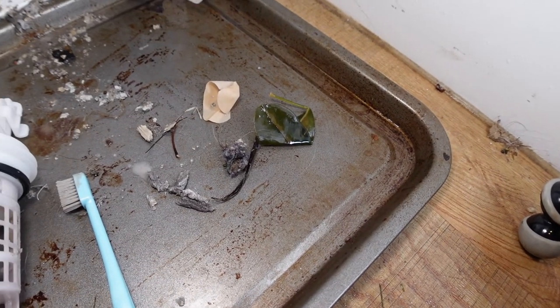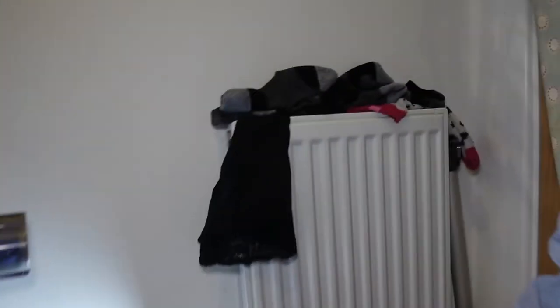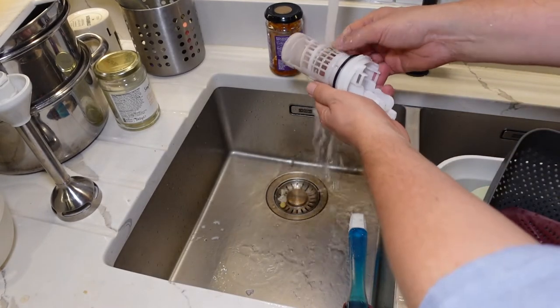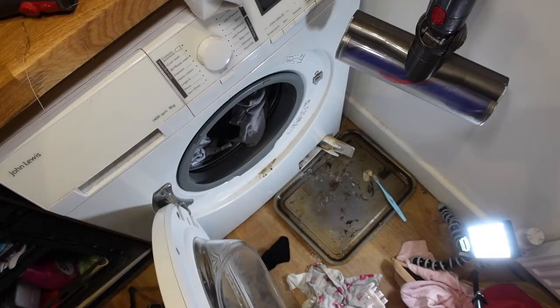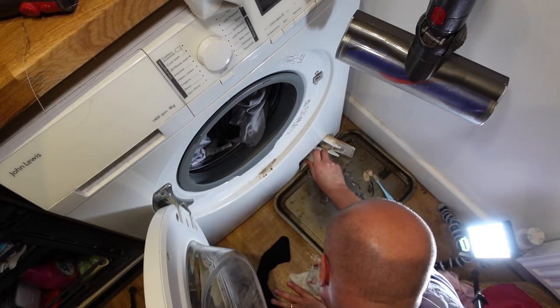I thought there'd be more in there, so that's good — but it's all encrusted around here and that's why it didn't turn. I need a brush. I've got an old toothbrush — I hope it's old — and I'm just going to scrape this. It's got right into the thread, it's just really gunked up. I'm really delighted that we managed to turn it and get the filter lid open, because if you can't get that open it's bad news. You'd have to look up YouTube videos on how to put your washing machine on its back and unscrew pumps and clips. We've just about caught it in time — five years. Now to slot it back in — it's just so much easier to turn now.